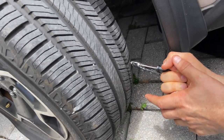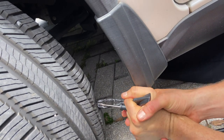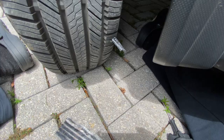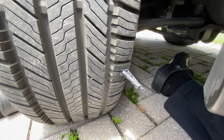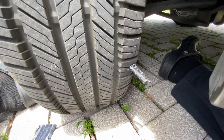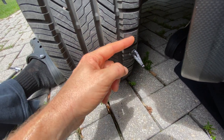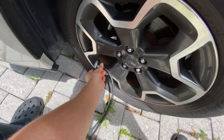We're going to put it on top of here, and this rubber cement will actually help seal the tire itself — just put a whole bunch in there. So back to where we put it — this is right where we got the hole at. This thing is still kind of in the way a little bit; I'm trying to do this left-handed if I can. This is where it takes a lot of strength to push it in there. I'm sorry I didn't get to see the final effort of putting that in there, but I had to really cram it in there. Once this goes in, you can actually take a pair of scissors or a straight blade and clip this right off. So we've got the plug in and we're going to pump the tire up.